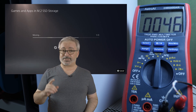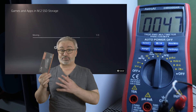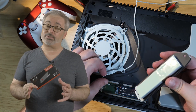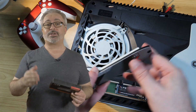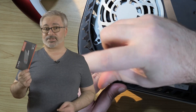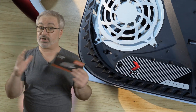To be fair and open about this being a sponsored video, featuring competing products is difficult, so I didn't test against the third-party heat spreader I had been using. But this product is specifically designed for use with raw drives, not to replace pre-installed heatsinks, so this data is relevant to that and points out how important a good heatsink is regardless. Somewhere between 60 and 70 degrees Celsius is where you start seeing drives throttle down, and the closer you get to that max temperature, the more likely you are to experience thermal throttling, as some do it incrementally. Lower and more consistent temperatures are also better for the overall lifespan of SSDs and most electronics in general, because you're reducing the physical strain of thermal expansion and contraction cycles.